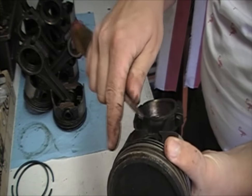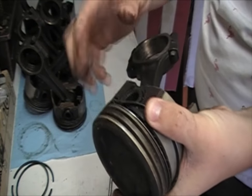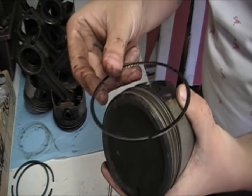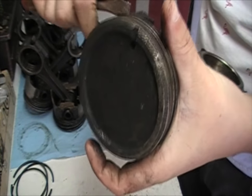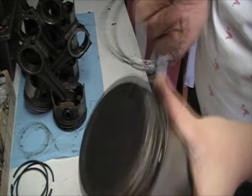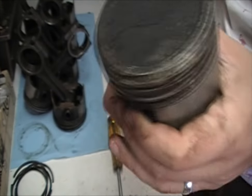For this one it's the same thing — you've got two rings on the outside and the oil slinger ring on the inside. Just push this out until you get it free. You want to be careful; this is not something you want to rush through. Hold it so it's not going to mar anything and work it around so nothing scrapes. Take your other outer ring off, and then once you remove the first ring, the middle ring will want to move and may pop out on its own — go ahead and pull that right out. Then take out the other outer ring. All of them are now out of there.